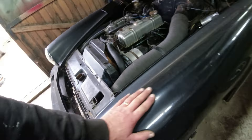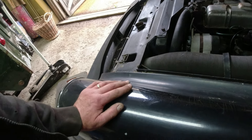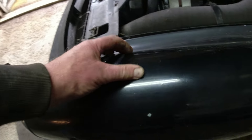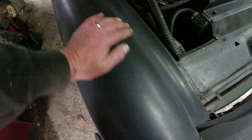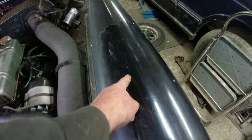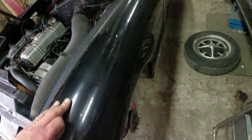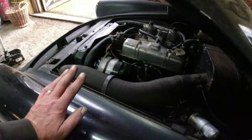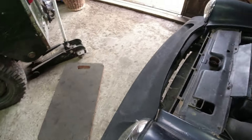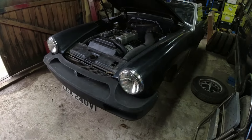This side I think has been repainted - the paint has crazed and also micro-blistered, whereas the other wing hasn't. I think the other side is original paint - no micro blistering, no crazing. Over here you can see the paint has shrunk and there's micro blistering all over it continuing onto the bonnet. I suspect it's had a repaint or a replacement wing and bonnet at some point.